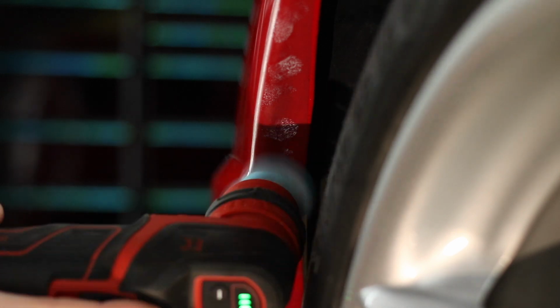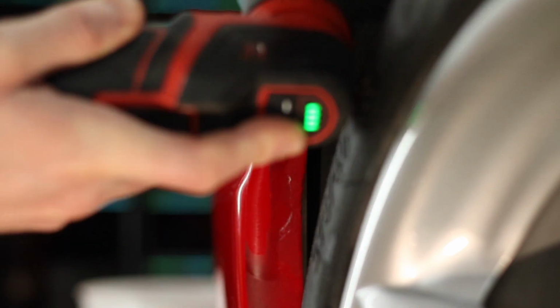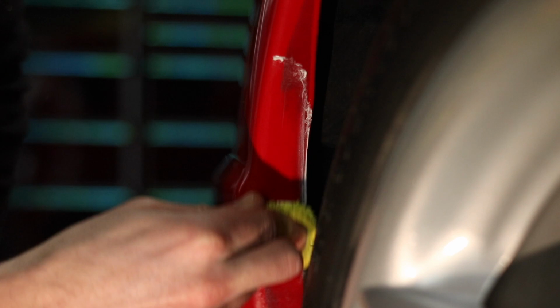Now, being original, this car still had the factory PPF strips around front and rear wheel arches. However, the PPF over the course of 18 years obviously had degraded, aged, and just looked matte and horrific. A little bit of polish on the little 1-inch pad and an old pad. Little polish up, and instantly you can see it pulling out the dirt. This wasn't a swirl removal thing. This was to pull the dirt out. No, unfortunately I couldn't get the polisher in there all the way, so what do? A little bit on a cloth, work it in.